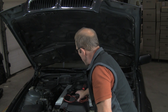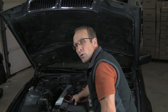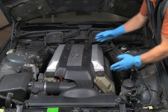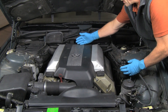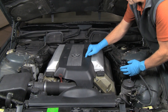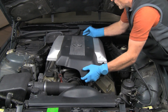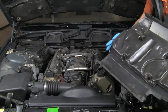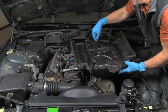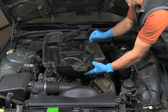These other gaskets you see here are for the throttle body and the throttle body mounting plate, which we might have to remove if we have problems with the two pipes that connect to these fittings here. Now the first thing we do in this job to access the back of the intake manifold is to remove this upper manifold cover. Very simple on the V8 — push these release buttons and those are all loose. We pull the cover off and set it aside.